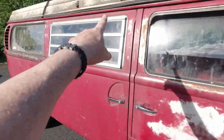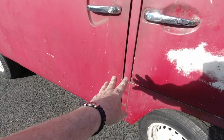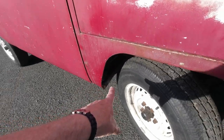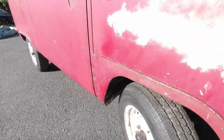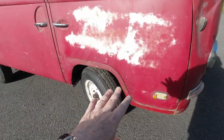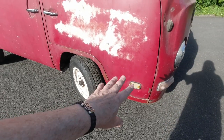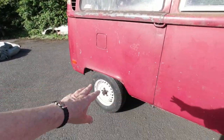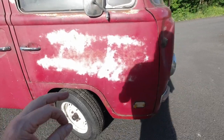From the bottom up. So as the water comes down from the top, it runs quicker. As it gets towards the bottom, it slows down more, because it has to cut through the grime and the road dust and dirt, where it collects. Anyway. It gets slower. And also drying out. It takes longer to dry out because there's grime and dirt, etc. So the bottom part of your vehicle, it don't matter what vehicle it is, it's going to take longer to dry out. Okay? That's the principle behind why these things rust out.